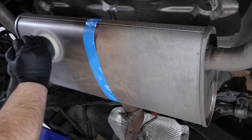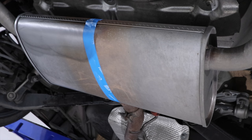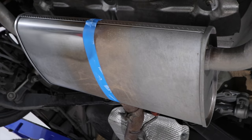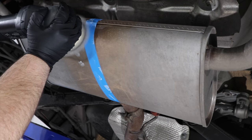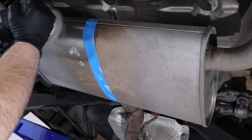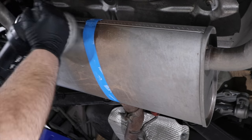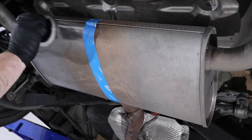I'll have links to the products I'm using in the description box, but quite honestly there's a whole bunch of different pads and compounds you can use to achieve the same results. You'll also notice that I'm using car paint compounds and polishers instead of metal ones. Apart from a very few select car metal polishers, most of them are just for light polishing — they have minimal or no abrasives and rely on chemicals to lift oxidation and minor blemishes. I've personally found that car paint compounds are far more effective at tackling badly worn and degraded metal parts. You can also use these compounds to polish metal by hand, but it's going to take at least ten times longer at best.